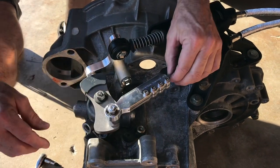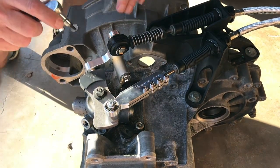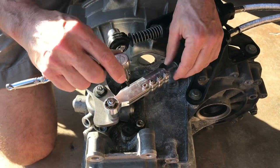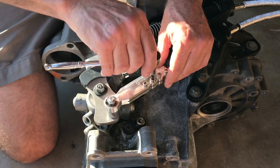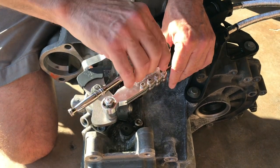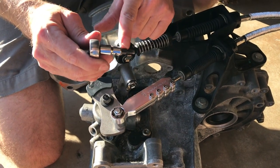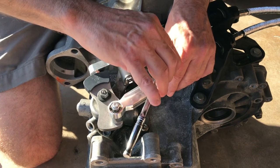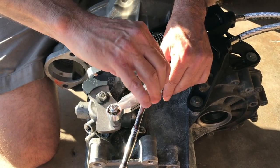And on the front to back, you're just going to tighten the 4 screws. So what you're going to do is gently go through one by one, and you're just going to get a little bit of swing out of each of the screws with a 4mm or 5/32 socket. And I like using a 1/4" drive because it gives me more control than a 3/8 socket.